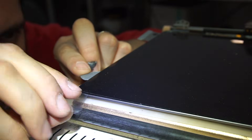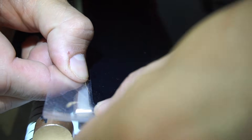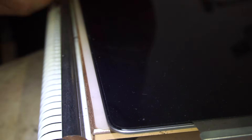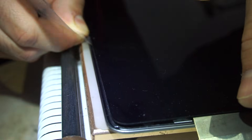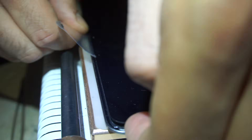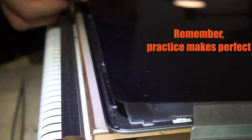If you leave the heat on for a long time, you will damage the backlight film. You can buy the backlight film online and it's not that expensive, but it is time-consuming to replace. The hardest part is the top section — there's more glue and you'll need to pay attention to the camera. Most importantly, don't rush. Take your time and keep an eye on the heat. It's better if it takes 30 to 40 minutes than to damage the screen or the backlight film.